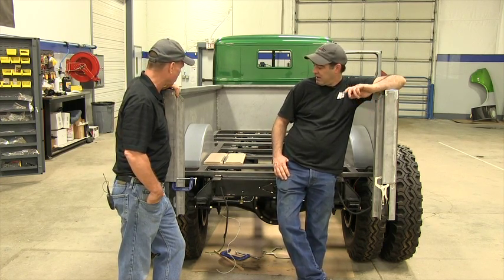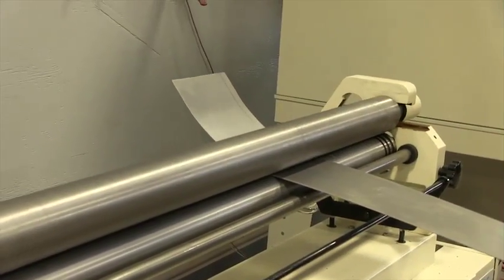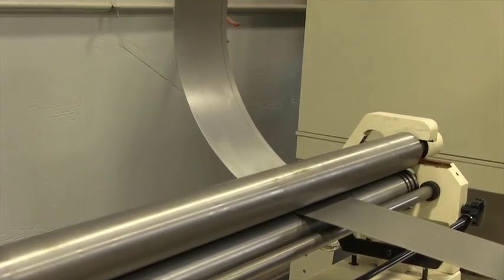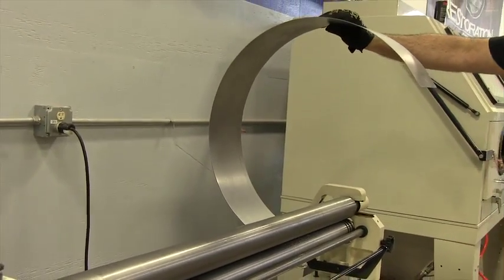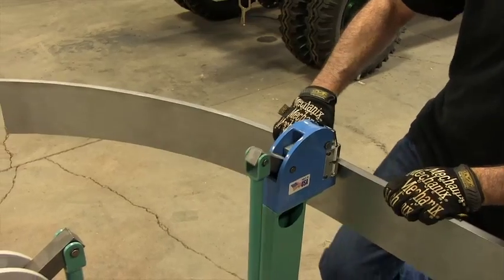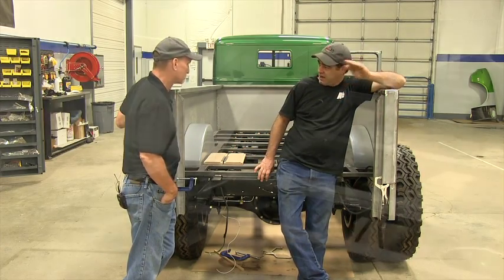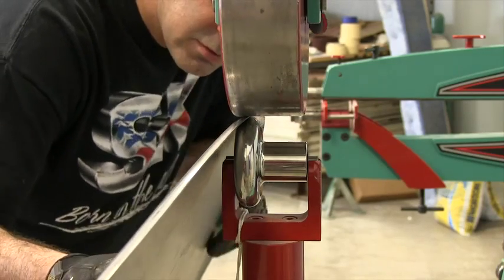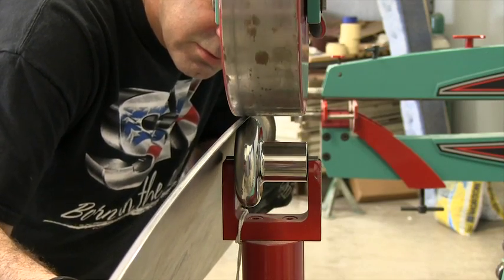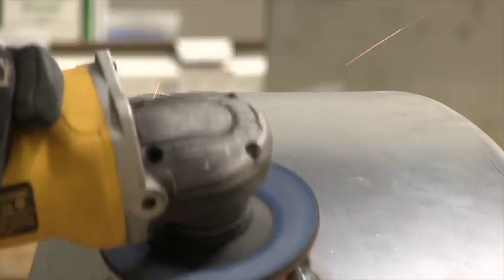Well, the wheel tubs are actually two different pieces of metal welded together to make one. I made a template to follow my pieces off of, and once I got my measurements off the template, I cut the first piece — the top half. I ran it through a slip roll to get the radius so the sheet metal had developed a memory of being in that radius. Then I flattened out one end, broke a 90-degree bend over on it, and came in with a shrinker stretcher to pull that in and get my radius back into it. For the inner piece, I wanted a radius on it so it didn't just look like a sharp 90, so I stuck it in the English wheel to get a little bit of a lip on it. Then I was able to load it into the bead roller and continue that radius on over. From that point I welded the two pieces together, ground them down with the flap disc, and that was pretty much finished.